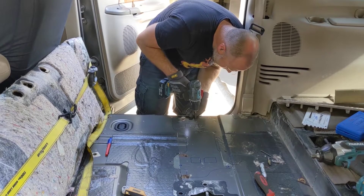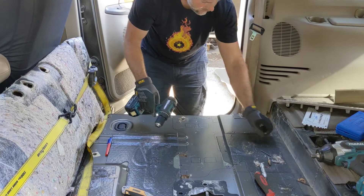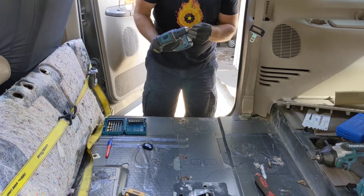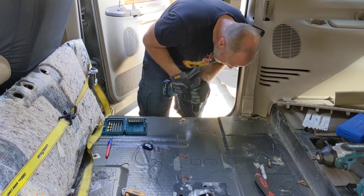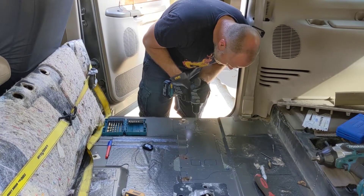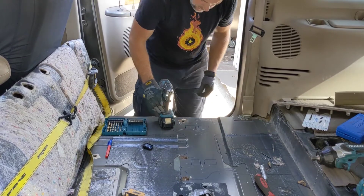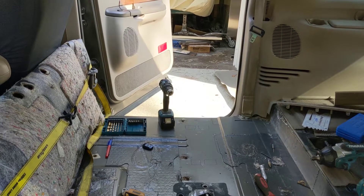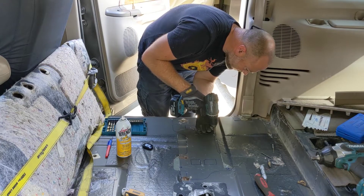Just through — and I broke the bit. There you have it. I hate small drill bits. Next, I'll go up a size here. I'm going to go get a little oil. I just use some cheap penetrating oil to spray the bit — use it as kind of a cutting oil. Helps to keep the bit a little cooler so it cuts better.